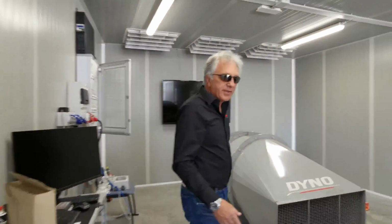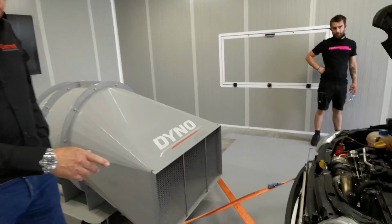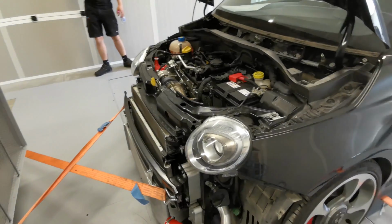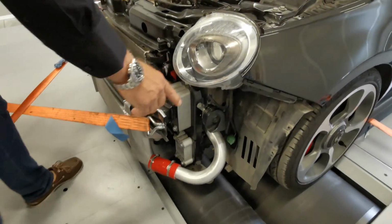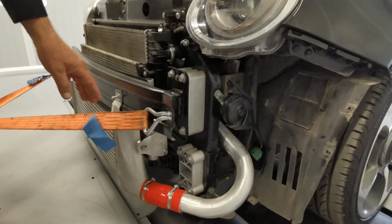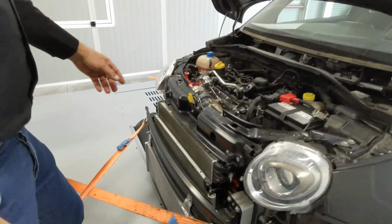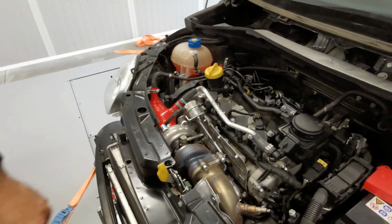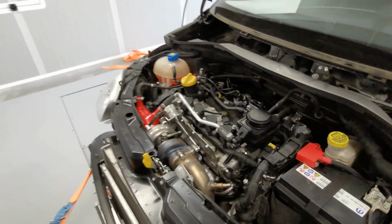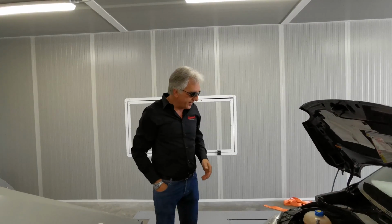They are specialized in the tuning of this car. They are installing the Borg kit for a large intercooler. They replace the two small intercoolers, and we put one on the front side. It's a large type. And they install the Mitsubishi turbocharger with all the components. Of course, they completely readjust the settings of the engine, so the ECU is completely revised.